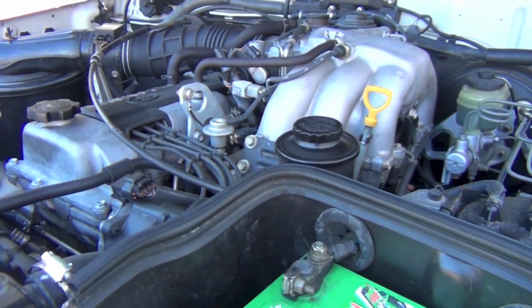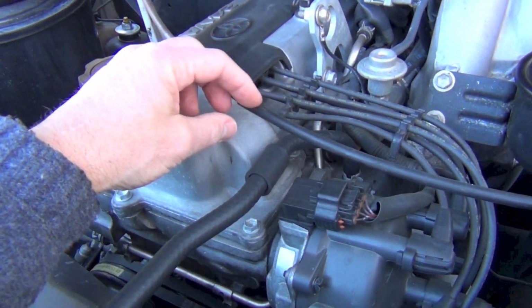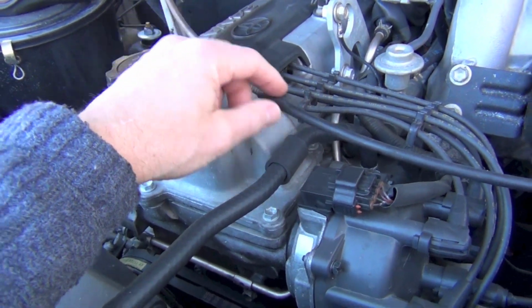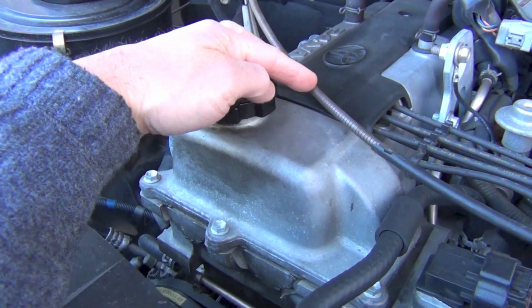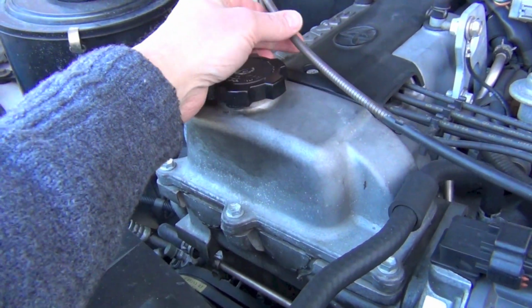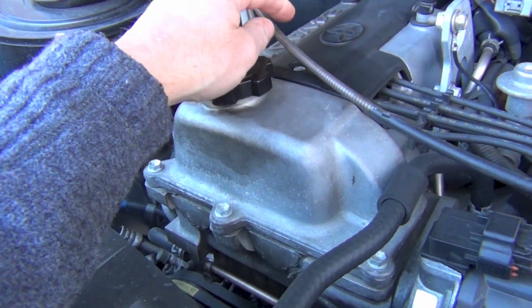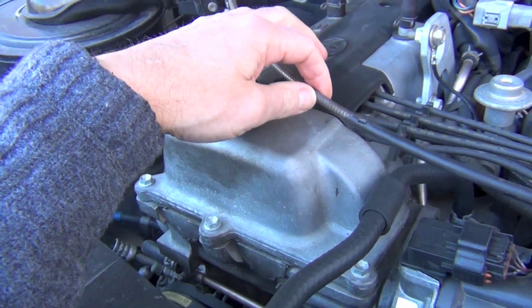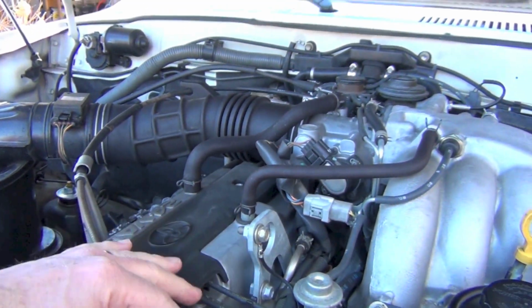But if you look here, this cable is really worn. It's been in the heat and all the sheathing is coming off. And when that happens, all of this area right here can let in little grit and grime. Then the internal cable starts to wear. So this could be my culprit right here, is the cable itself might be binding up right at the beginning of the pull.